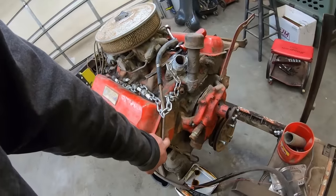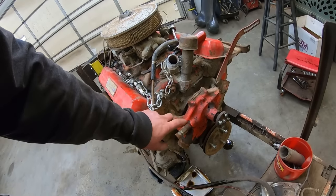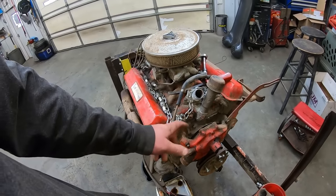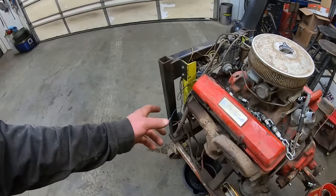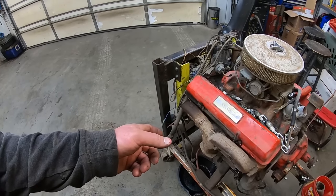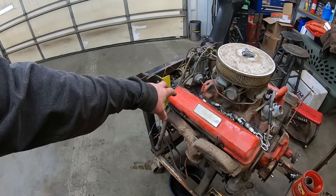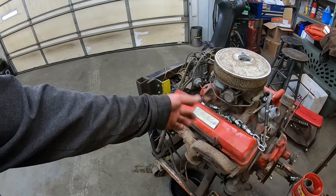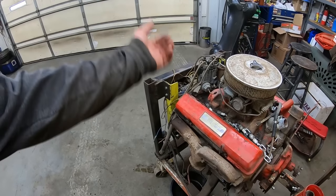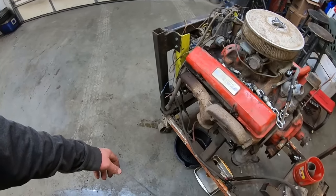We do know they're Camelbacks, they're early ones that don't have the provisions for the front mount accessories, which I think some of the later ones had. Could be wrong. Anyway, we will do that. We'll drain the oil, pull those valve covers off, and then we'll prime it. And then with the valve cover off, we'll be able to know when we got oil all the way to the top end here, because that's the last place to get oil. Right? Right. Bottom up. Okay.